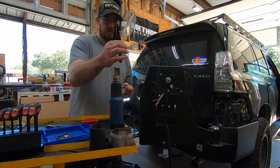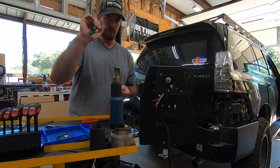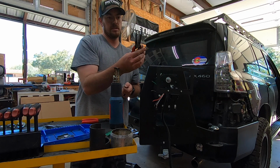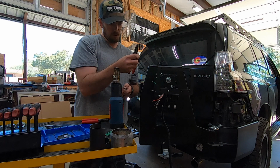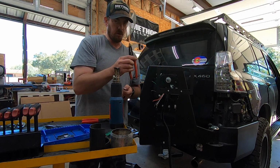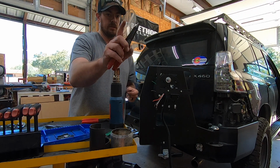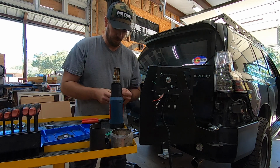But these ones you get right here, they go down to 26 gauge. So this is in your Lowe's, your Home Depot, your Menards, that kind of stuff. Those little guys right there. Guys, I've been finding these for like $16, $17, less than 20 at all the big tool places. And they are for stranded, 10 through 20. But the 20s aren't quite tight enough for the factory Toyota wiring I've found. But I really like the way these are ground, and I like having the needle nose on the front side. So those are kind of my go-tos these days.